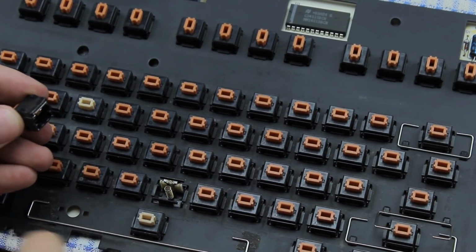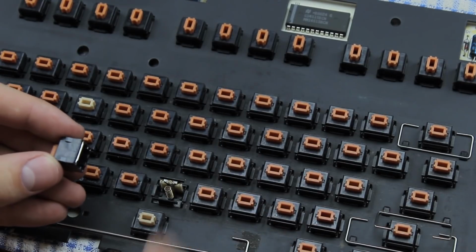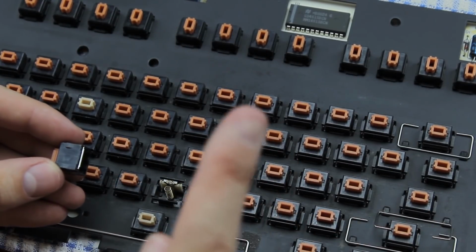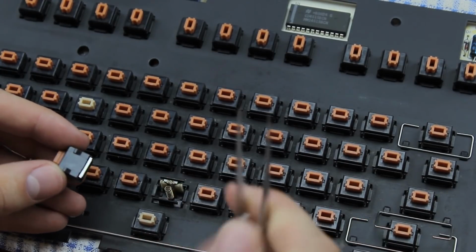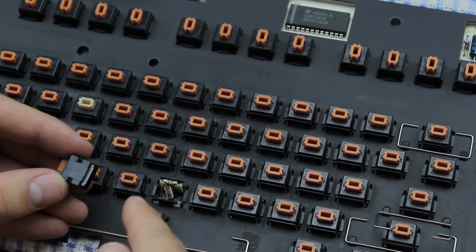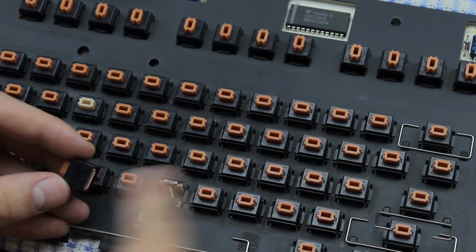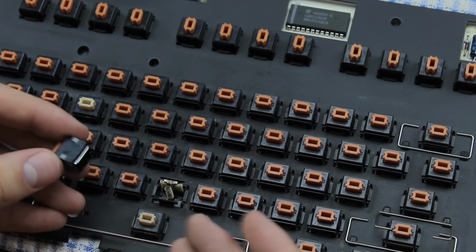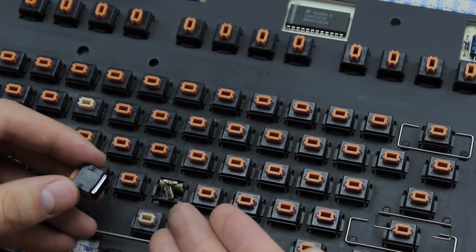You can also use only the toothpicks to do it without leaving any scars at all, but this is a faster method. Note, I would open each and clean each switch separately to avoid mixing up any of the parts at this point. If you keep the same slider, leaf spring and housing with the same switches, I think it gives a better result. These same parts have been mated in the switch for around 20 to 30 years by now after all, so as they are, they probably fit each other the best.